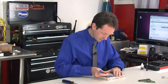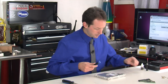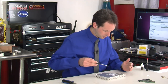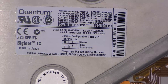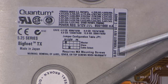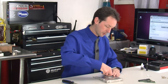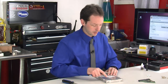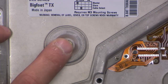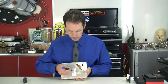We're going to see what's under the seals. I'll just use this screwdriver to pop the seals. There — we voided the warranty. This is an older drive; I wish I could find a year on this. I don't see any kind of year indicator. Maybe somebody out there can find it — maybe there's a year code somewhere. It's probably an eight gig drive; it says eight to twelve on here. When were we doing eight gig drives? It's a long time ago. We're at two terabytes now. There's a little Phillips head here under this seal, and that'll be the spindle there. There's the armature spindle and this will be the main spindle.